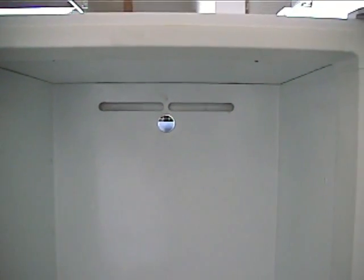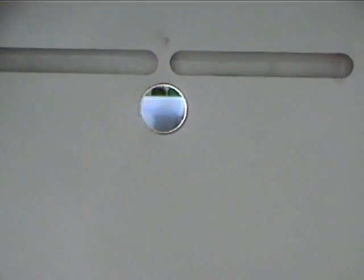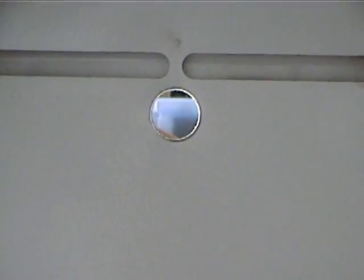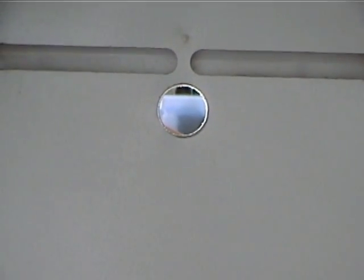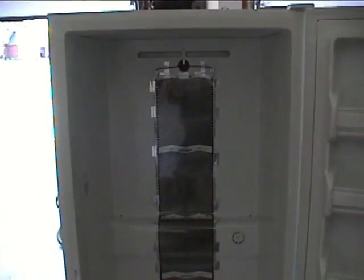At this point I've drilled a hole in the back of the refrigerator. A two-inch hole saw was the smallest I had. Not to worry though — I've got a solution to close it off. After I run the cord through for the heat tape, I'm going to tape some aluminum foil tape on the back of it, then fill it with expanding foam, then tape the inside. So it'll be just like insulation all the way through. That's the hole for the power cord for the heat tape to go through.